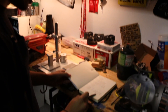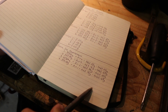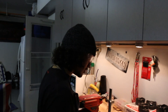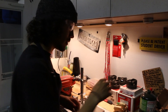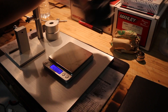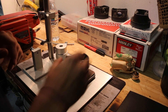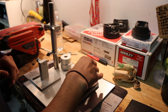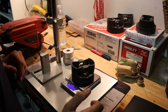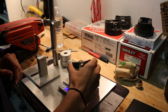All right, we got all four pistons and their corresponding pins recorded, and they're all even after the weight reduction. For peace of mind I'm going to go through each one — as long as they're within a tenth of a gram I'm not going to freak out too much. Piston one reads 462.68, piston two reads 462.66, and piston three is reading 462.66 to 462.68.